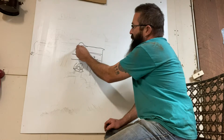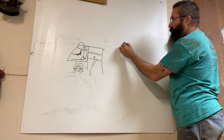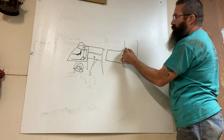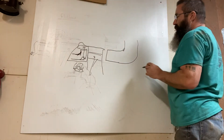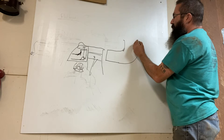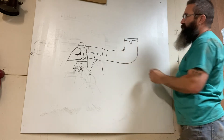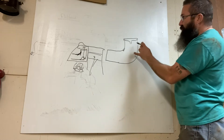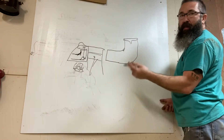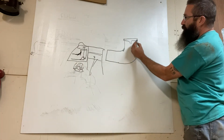As far as the port itself, I'm going to take this part of the drawing and blow it up big with my magic marker. There's our port — nice short turn, got rid of that sharp edge. We've talked about the valve guide. We've already done stage one where this port opening is. Your valve sits right here — that's your valve. This is your 30-degree, or on some engines 45-degree, seat.